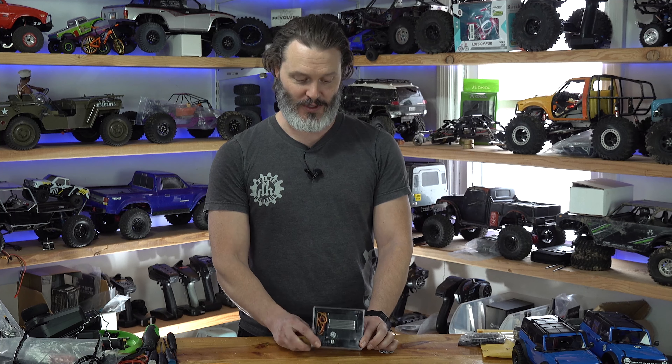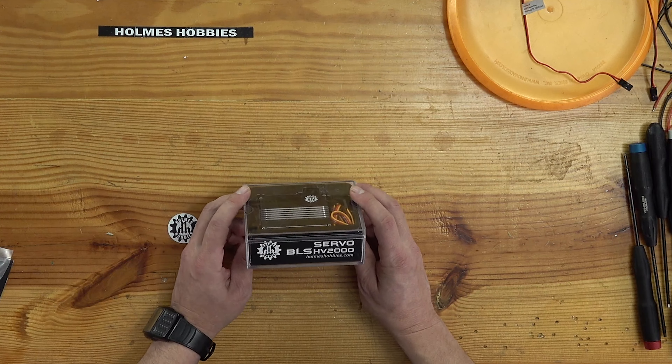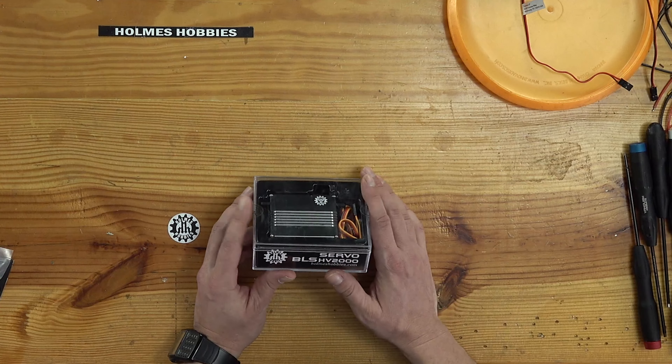It produces a little bit of torque. On 8.4 volts — and I'll just say this is an HV servo, not an SHV, so this is not direct power — you would use a BEC for this and power it directly through your radio or through a bypass adapter that we do sell on the website. The reason I chose the HV instead of SHV for this particular model is that on the SCX6 and many sixth-scale and fifth-scale rigs, the operating voltage is extremely unpredictable.